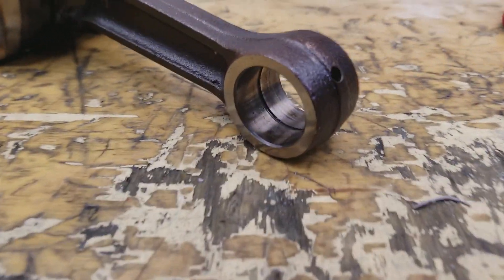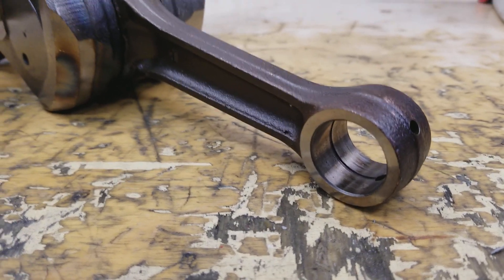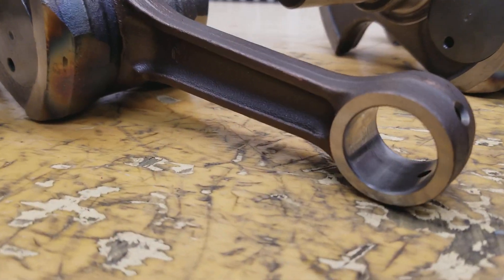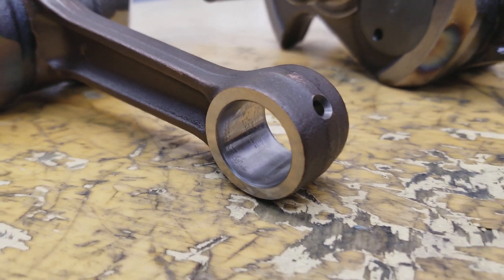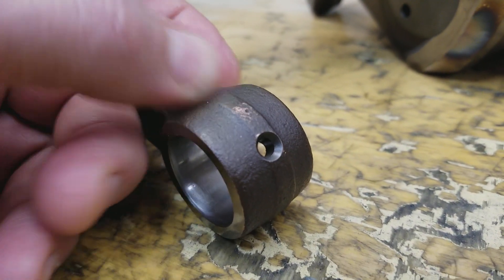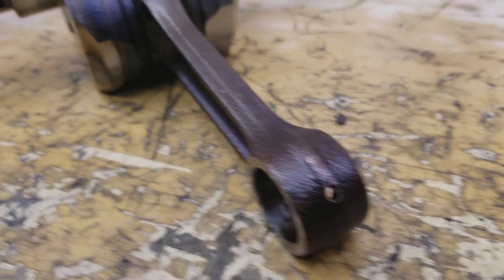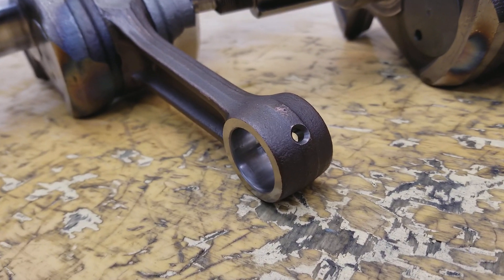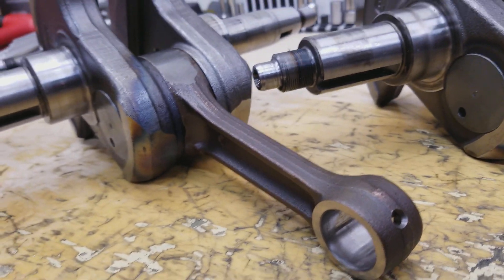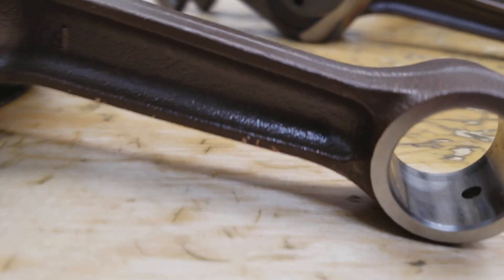This earlier rod has an oiling groove through the center line of the rod to help oil feed all the way around the wrist pin and then go out from the center. When they switched from the 2006–2012 rod to the 2013 rod, they got rid of that center oil groove entirely. But they did chamfer the oiling holes to help feed oil a little better — chamfering the oil hole allows oil to break surface tension more easily and drop in, as well as having a larger area to feed from. They carried that chamfered hole forward into the 2015 and above, still with no groove.